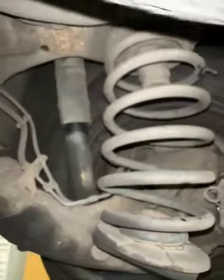Again, your rear brake pads are on about 30% — a little bit hard to see, but I'll get an angle for you. The rear discs are lipped. Looking at the rear suspension in this corner of the vehicle, there's nothing to flag.